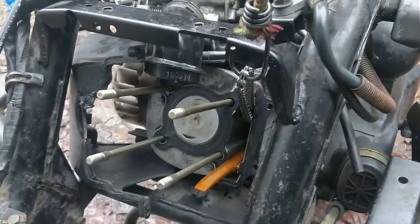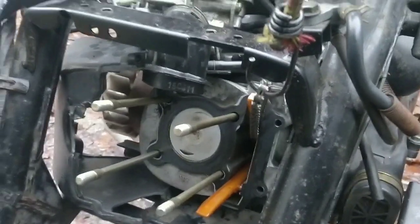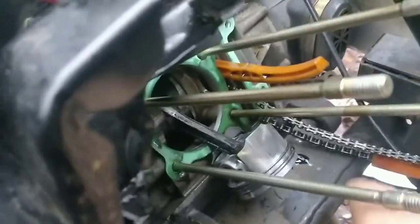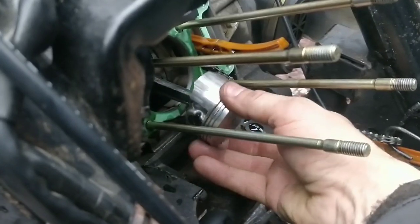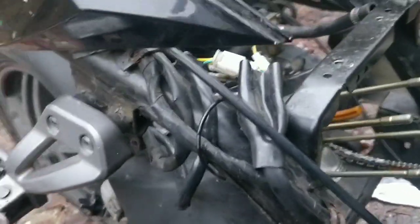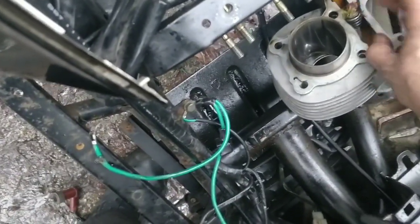Let me pop this off and see exactly what's going on. That piston fits so well - it's spot on, but I think absolute half a millimetre off if those guide pins were needed. Piston and rings look great, no cracks, no problems there - excellent. Bottom gasket is fine and still ready to go. Guide pins... one there and one there guys - look at that! As in, they weren't on and they should be.